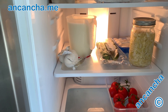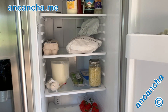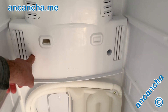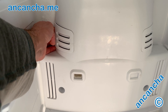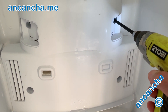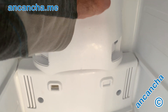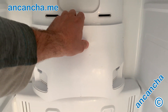Here's what you're going to have to do. First things first: switch off your fridge freezer completely. Next, empty it — most of it anyway. The part you want to remove is this part here, and it's got a couple of screws — one there, one there — and these clips come off, and there's another screw either side. You need a Phillips number 2 screwdriver. With the four retaining screws removed, you can try pulling it off or prising it off. But if it doesn't come off easily, don't force it — it will be jammed on with the ice.